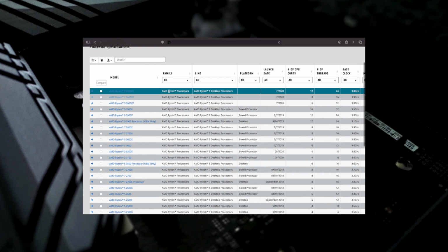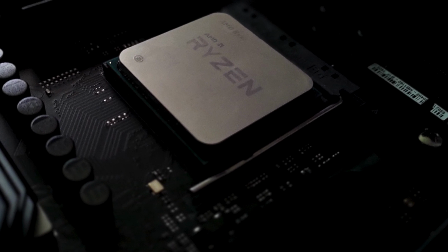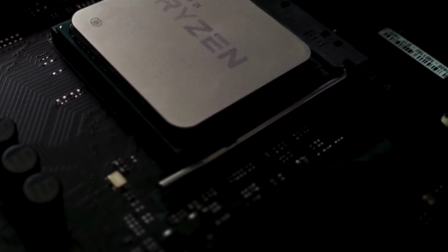So first, you can notice there is an iron rod beside the CPU slots. You can just pull the rod out from the slots a little bit, and then lift it up to a 90 degrees angle with the motherboard.